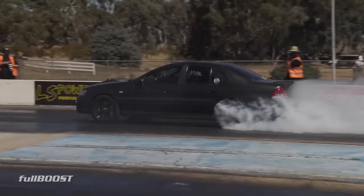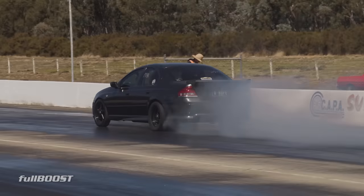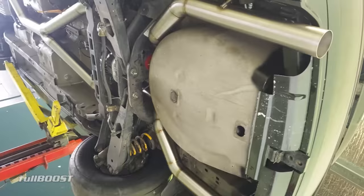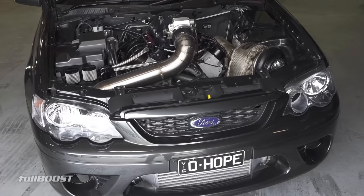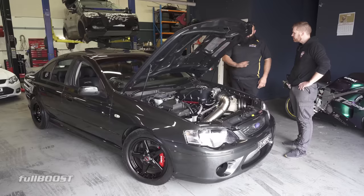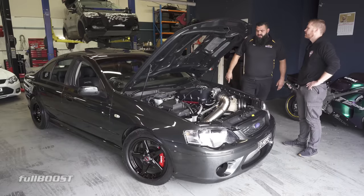It's been running for the last six months with no heat issues. Custom-made turbo manifolds and dump pipes. It's got a four-inch exhaust system all the way to the K-frame. Everything in-house. Pretty much the motor got mounted, the turbo works - everything was fabricated at Accentac.